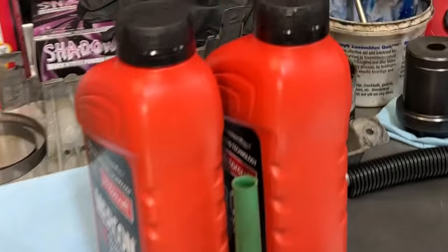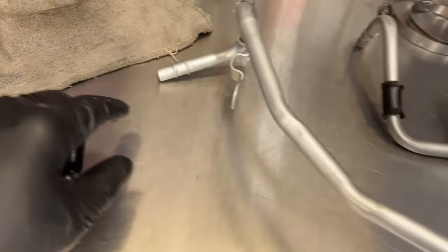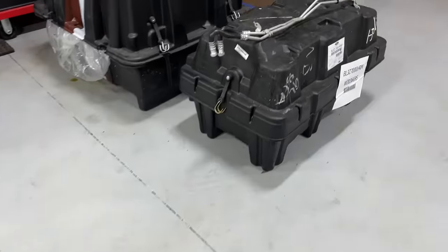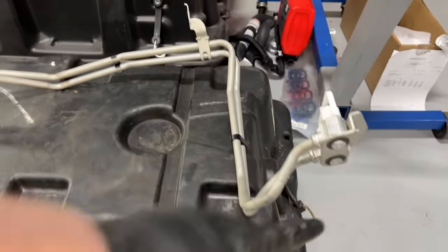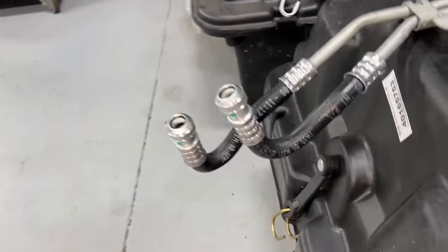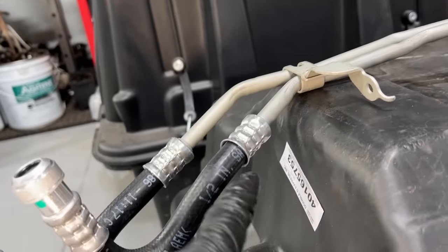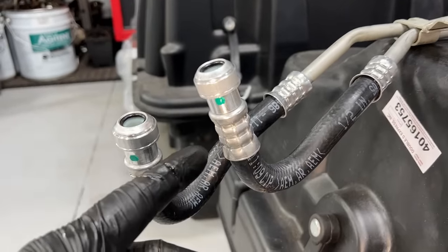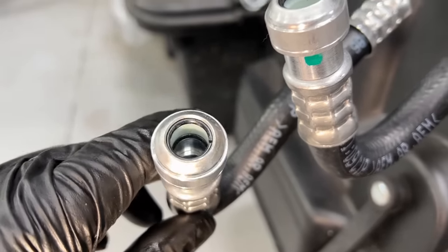Here's how it looks over here — the two jumper lines right here. Here's a jumper line that goes over to a quick connect that goes into the main line bundle, and here's the other one. This is how the bundle looks — brand new bundle from Ford. This is pretty much how it goes in: it bolts inside the trans, wraps under the pan, goes along the oil pan, comes over here, and that's where they section it off to clip into the jumpers to go into the auxiliary cooler or just the radiator, as on this vehicle. You can see it goes from a steel-to-aluminum crimp right here, and then here's the quick connect fitting with the snap lock ring and the o-rings.